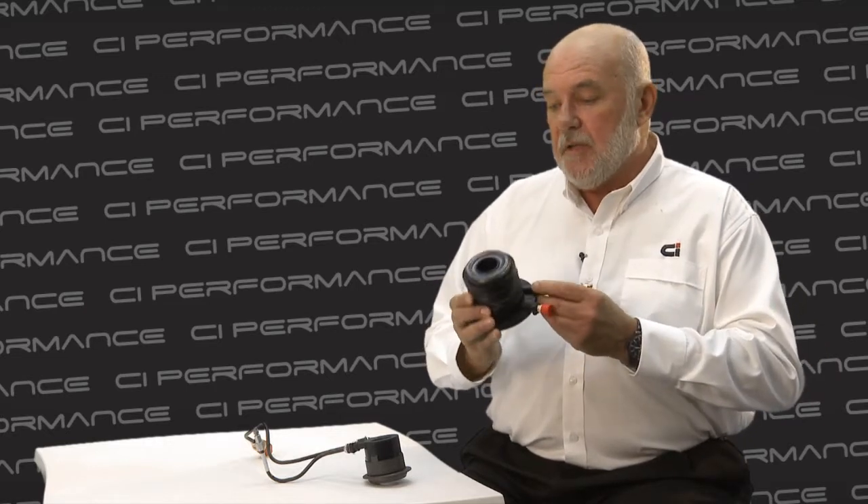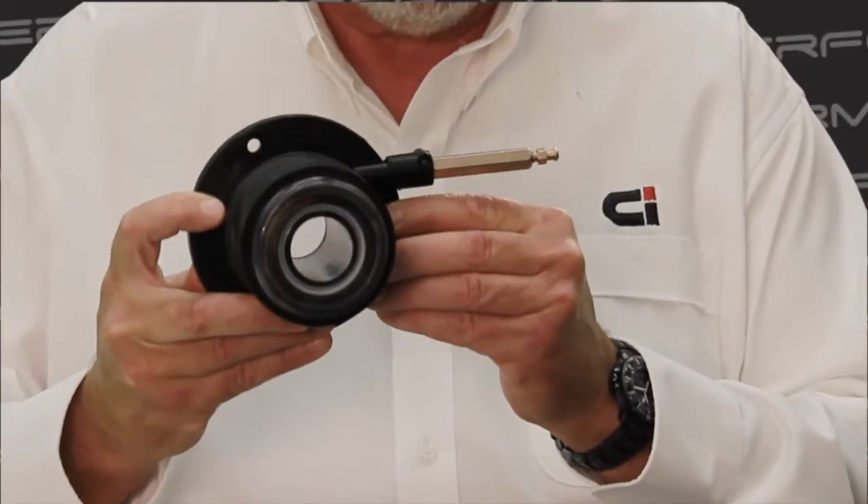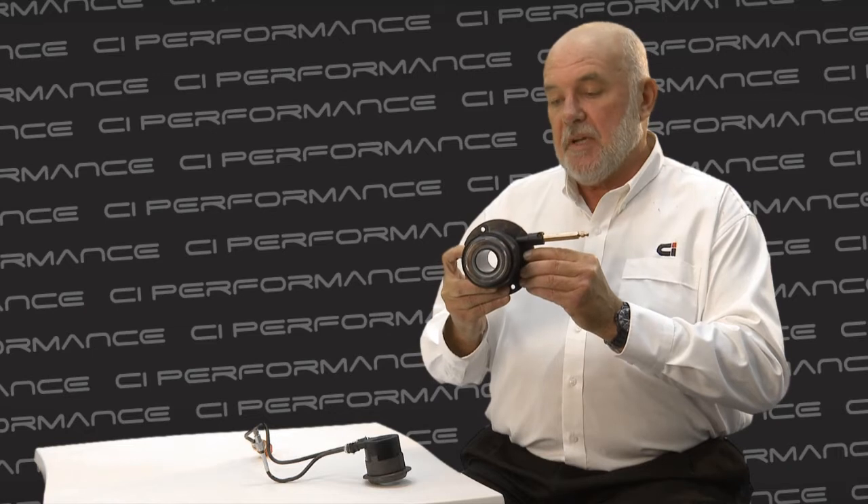What's becoming more and more common now is to mount the slave cylinder inside the transmission tunnel so that it operates directly on the surface of the pressure plate and gives a much more direct push than it does with an arm, which inherently has to move one way or the other. It's recommended that when you change the clutch you change the CSC, because it is very labour intensive to change the CSC again afterwards — you virtually have to redo the job.